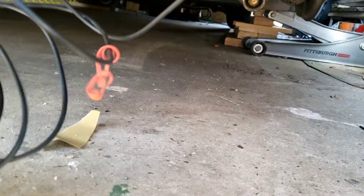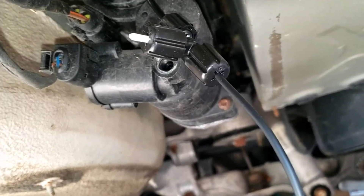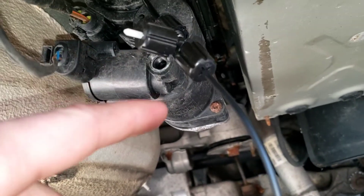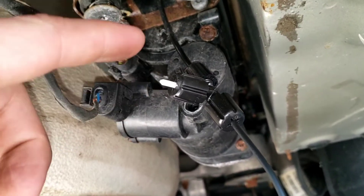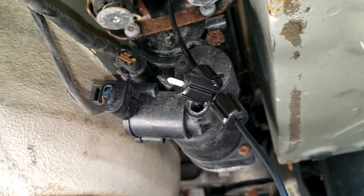I'm going to try and fish this up into my trunk so I don't have to dig under the car — at least for the temporary fix. So that should be a good understanding now of how to open the relay and how to attach air fittings here to pump air and manually pump up your airbags on an E61.